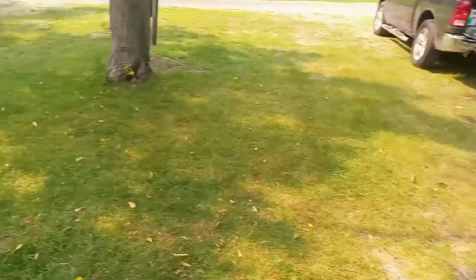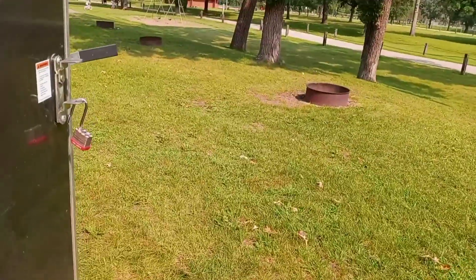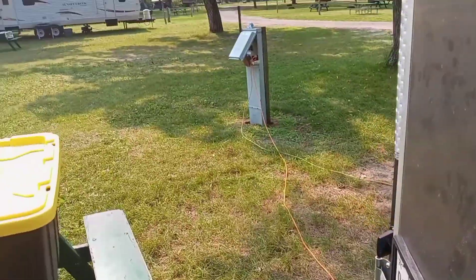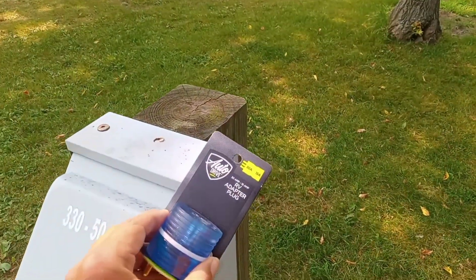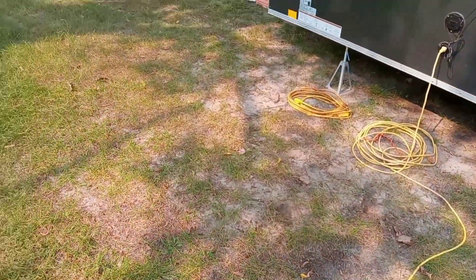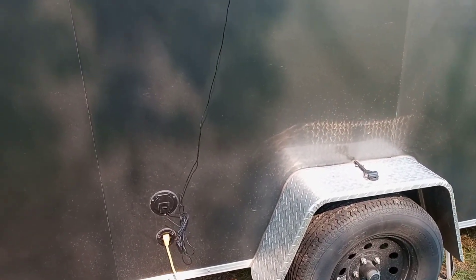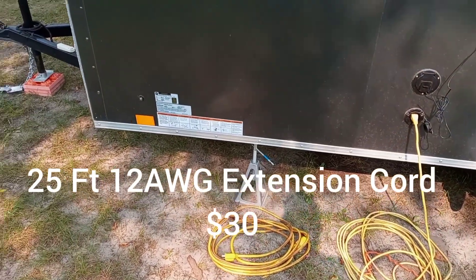Back to the topic — got 110 service running there, and got a little bit running over here on that separate plug. This over here just feeds a separate power strip, so if we want to charge our devices outside or still use the printer, we've got the options there. Another trick: you can grab one of these for about $5 or $6 from Walmart — a little 30-amp to 15-amp reducer. Go into the 30 right there, run yourself another cord, and then through that separate hatch you can go straight inside. If you want to run a dedicated heater or a separate small microwave, you've got that option. It's always recommended that you go with a 12 AWG power cord — those will carry 16 amps.